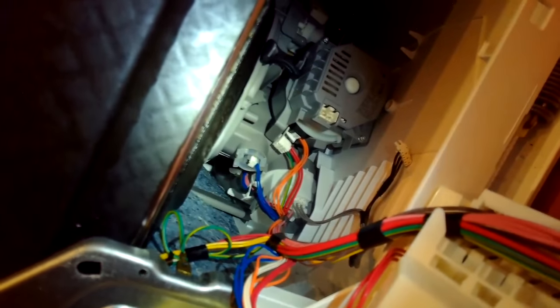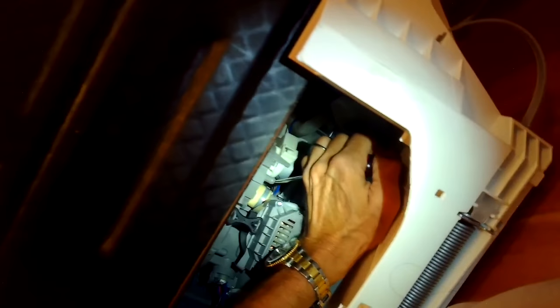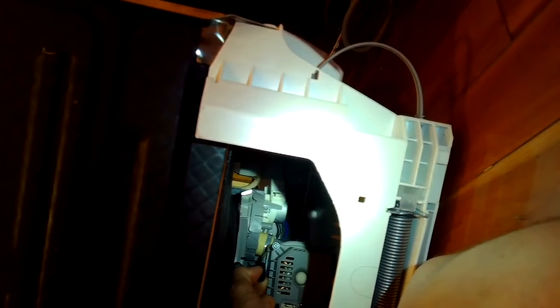There's also an orange wire — the orange one you'll probably pull out a little bit later once we get the motor further out. The red one you can just pull out now. We're going to pry back on the spring clip that's holding the circulation motor in place. It's a permanent clip, not adjustable, so just pry back with a standard head screwdriver — it'll release.